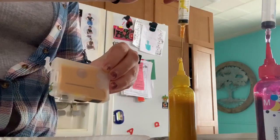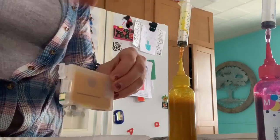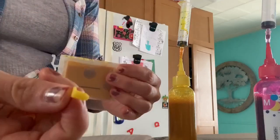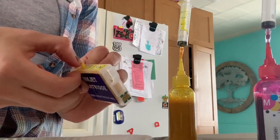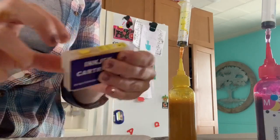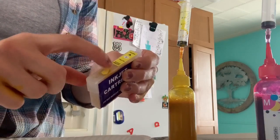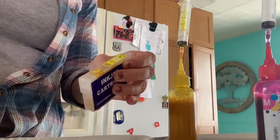Put any remaining ink back in the bottle if there's some left. Then take your rubber piece and place it right in the middle part — the fill tab — where you pulled the little rubber part out. Remember, you originally took it out of the vent and you're placing it in the fill, so the vent is going to be left open. That one's done.